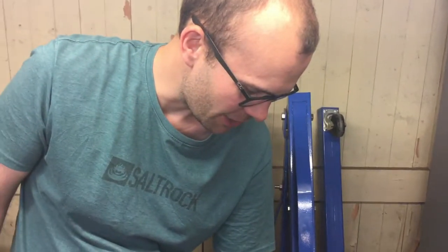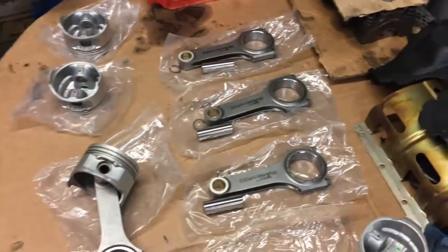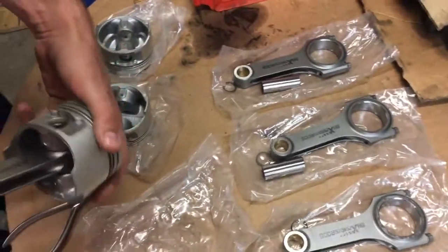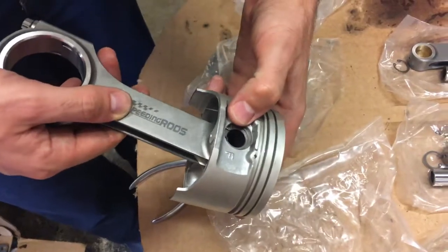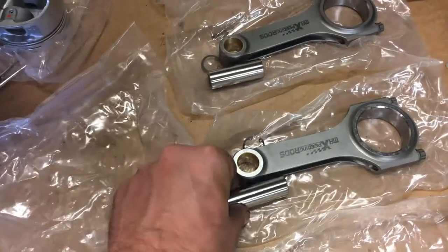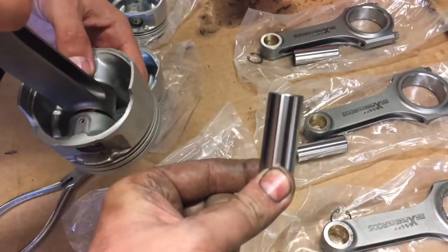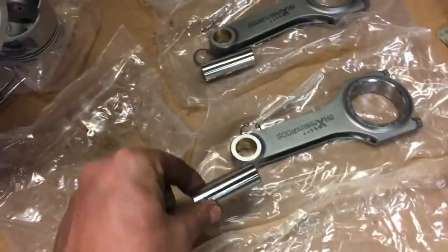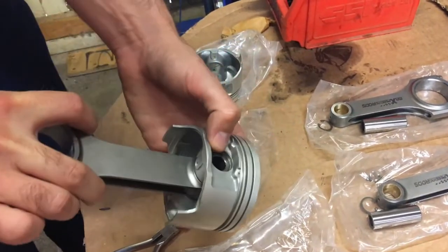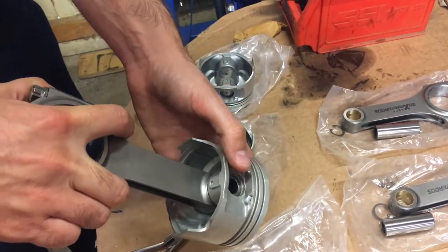So we're taking the con rods and we're connecting them to the pistons. Okay, and how are we doing that? Well, the first thing we're doing is putting in the retaining clip here. Then we're putting the bearing through the end of the piston. So that's this lovely guy here. Through the end of the con rod, the little end. Obviously, not the big end. That'd be silly. And then finally we're going to put another retaining pin at the end.